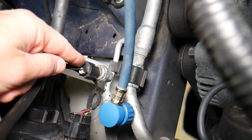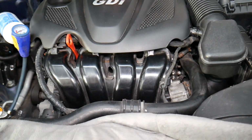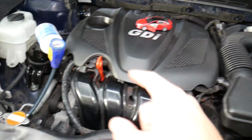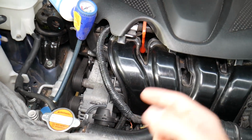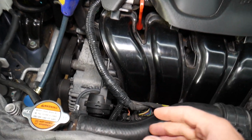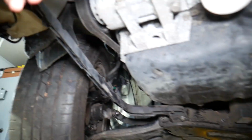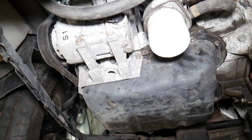So that sensor is super important, and you wonder why. When you press the AC switch on your Kia Optima inside, guys, the engine computer needs to determine how much pressure you have in the AC system. That way it knows if you have Freon, so it can safely activate the clutch and that way activate the compressor, which is driven by the serpentine belt. Then you can see the AC compressor. It's that device right there.